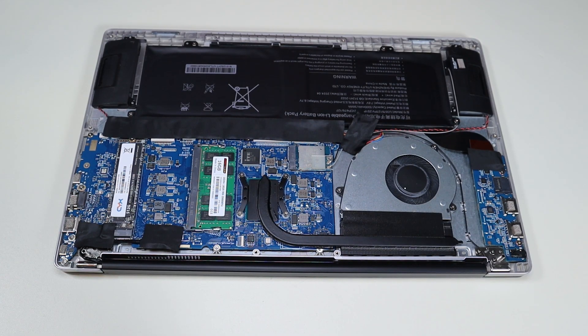Also in the description I will have another link — it'll be a list of all the replacement and upgrade parts for this specific model computer if you're looking to replace or upgrade them. Now the first thing I do before touching anything in a computer is I'll either remove or at least unplug my battery. A computer is safest to work on when as little power as possible is running through it.